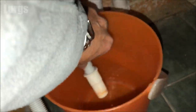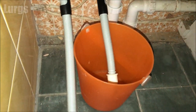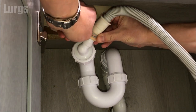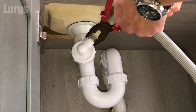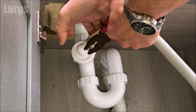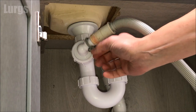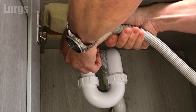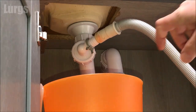As mentioned, you may have a type where the drainage hose is connected to a sink drainage system underneath the sink. You may have a metal clip on it — get a pair of pliers, squeeze that and it loosens off, then maneuver it away from the rubber hose. Get a good grip on the plastic pipework and the hose and start pulling that away. Make sure you've got your bucket ready because you will get some excess water out of this drainage hose. If there's no clip, it doesn't matter if it's a good tight fit.